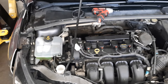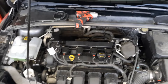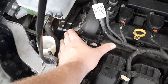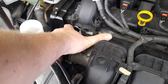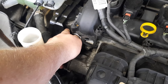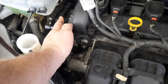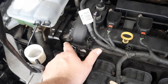Is your Ford Focus vibrating a lot at idle, making rattling noises and stuff shaking? This is a very common cause of that — the engine mount wears down, the rubber causes the engine to go down, and the mount will actually contact the metal of the mount itself. That's called grounding out, and that causes a lot of vibrations to resonate.